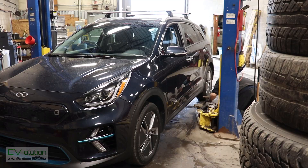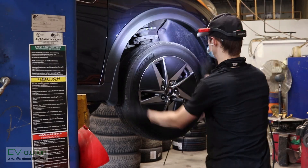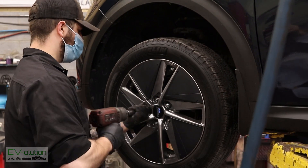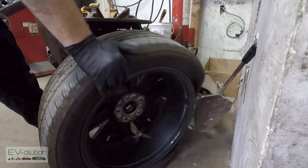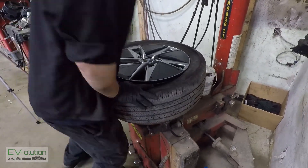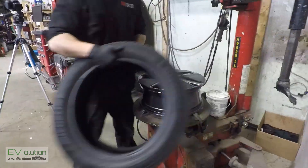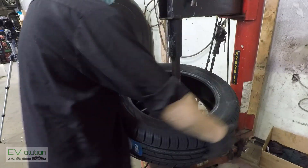If you've never seen how a garage changes tires and aligns a car, this part of the video will be interesting. It's important that the garage knows how to lift your electric car by not propping it up on the battery — they have to use the dedicated lifting points for your car. Once the wheels are off, they take the air out by removing the valve and valve stem, then use a machine to compress the tire off the lip of the rim. The same machine is used with a pry bar to remove the tire from the rim. They then lubricate the edge of the new tire that will contact the rim lip, making it easier to mount.